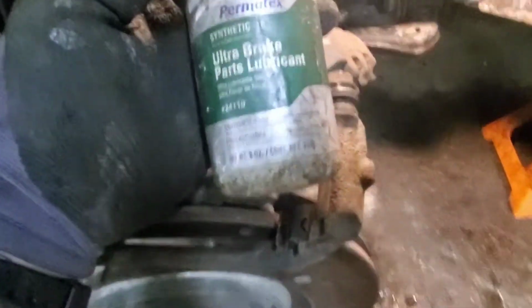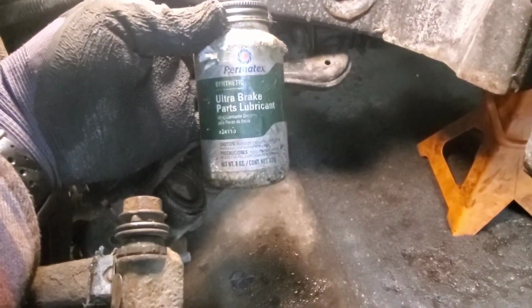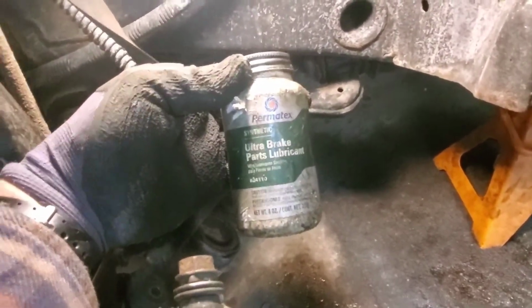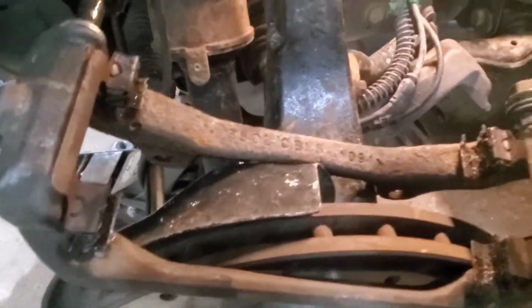And the grease I like to use, and I'm not sponsored by these guys or nothing, I just think it works well, is a Permatex. Let me get it in the light here. Ultra brake pad parts lubricant, and it's synthetic and it's got a high heat on it. So it works really well. I use it in the BMW, I use it in this thing, any of the brake caliper parts, or even I've used it on the lug nuts and they work well. So, just something to think about.